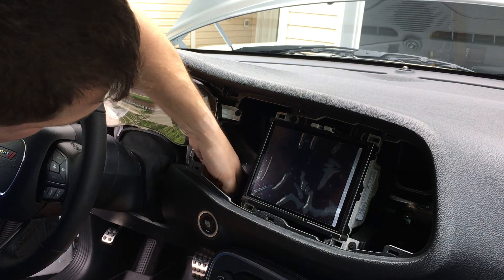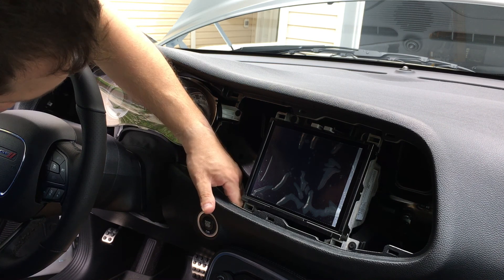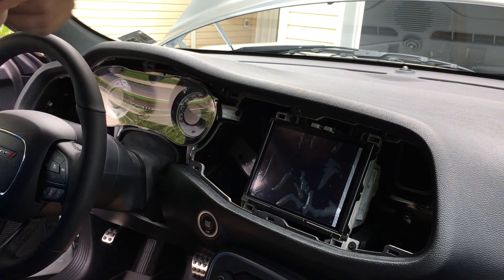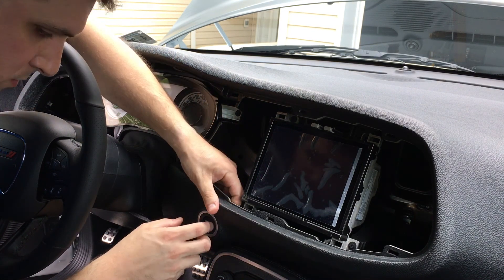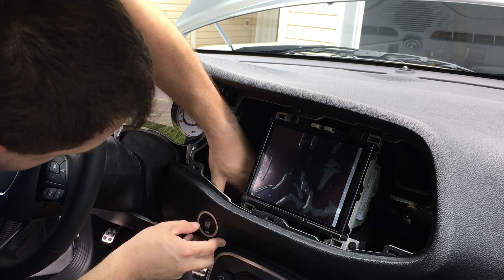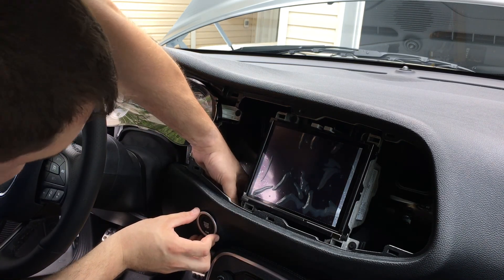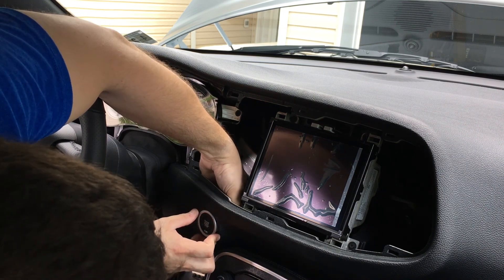I don't know how I'm going to position my hand. All the way on the bottom there's a piece of plastic in the way holding what the radio is screwed into. I'm going to try and push the top two first, so there's one on the bottom and two on top. There's a groove on top — there's one popped. Got the other one — there's two. Got to reach into a weird position — there we go, two and three, perfect.